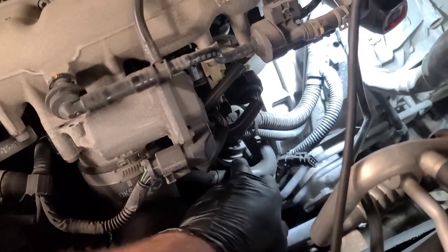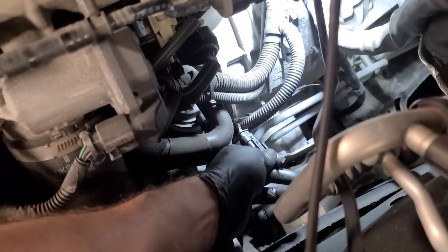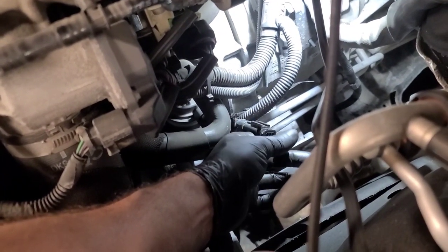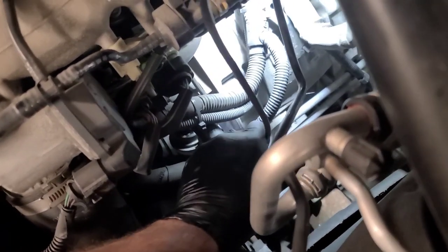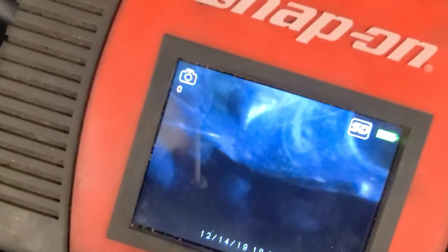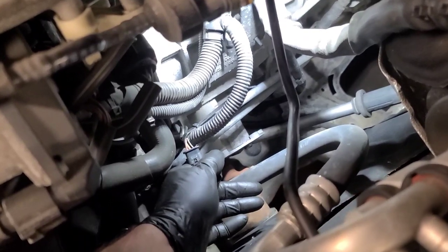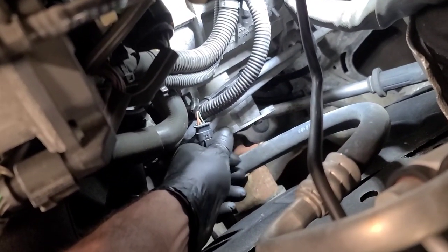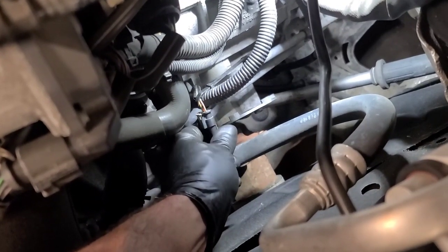It's down in the left rear corner of the engine — you can just see the housing of it there. But I see this connector hanging here and it's obviously been unplugged and taped up. I don't know why somebody would disconnect that coolant pump, but it's disconnected. I'm looking in there with the borescope at the connector. I double-checked on the schematic and those are the wire colors — there's a gray and blue, yellow and orange.